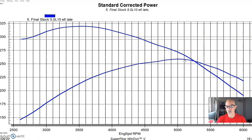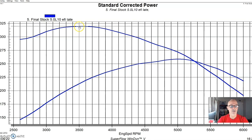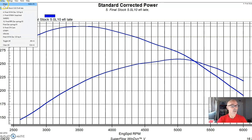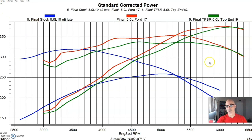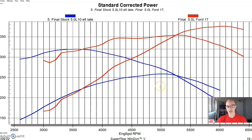In stock trim with long tube headers, electric water pump, and optimally tuned with the Holley HP management system, this thing made 258 horsepower and about 320 foot-pounds of torque - what we've come to expect from factory 5-liter combinations. Power fell off dramatically after 5000 RPM, typical of the factory HO intake manifold. When we installed the Trick Flow top-end kit, I accidentally brought up the TFSR short runner version first, which didn't do nearly as well. Here is the combination with the long runner Street Burner intake - much better than the short runner TFSR intake all the way through the curve.